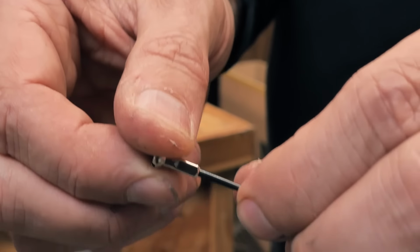If you see threads poking out here or here, that's pretty bad. And as a rough guide, you can just go around and you can normally feel loose spokes. If you've got loose spokes from a wheel, new out of the box, you need to send that back straight away. They should all feel pretty balanced. This is a massive subject. We could spend hours on this subject alone, but hopefully that's just enough information for you to decide, are you looking at a good quality product or not?